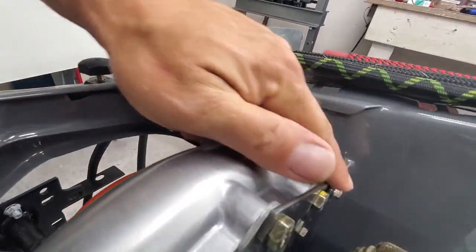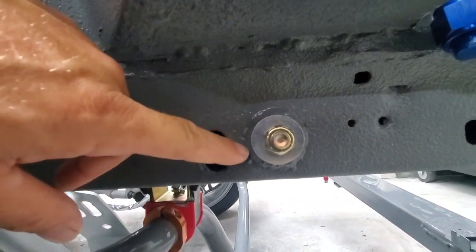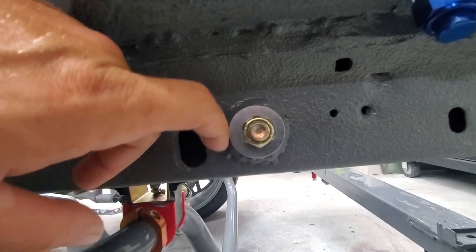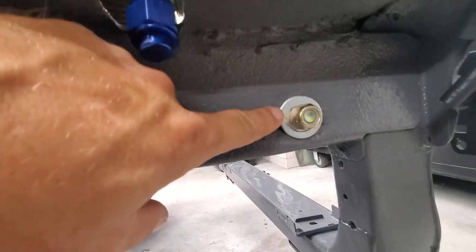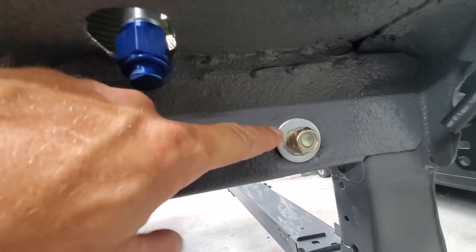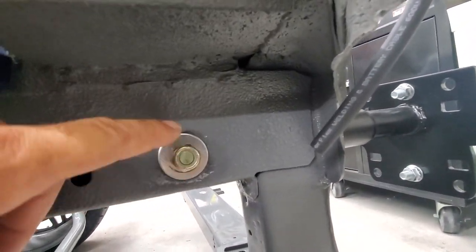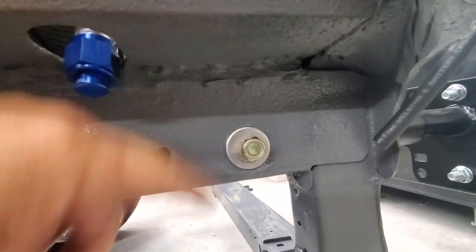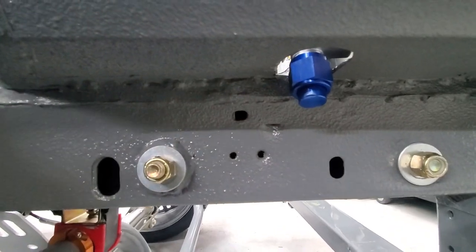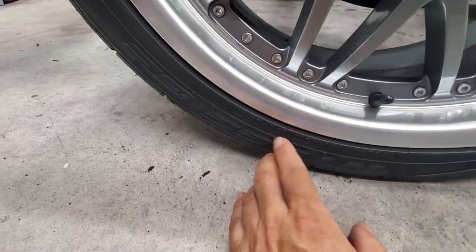Clean setup. I made a little mount right here, and I welded a piece of DOM pipe into the frame so when you tighten it down it doesn't crush on itself like the fronts do. That bracket slides into the frame rail — it captures the end of that tube with a ring and that's all it holds. Turbo drain and all that. SVE wheels from LMR — 255/35/20 up front and 285/35/20 in the back.